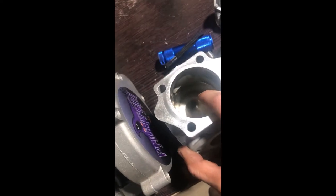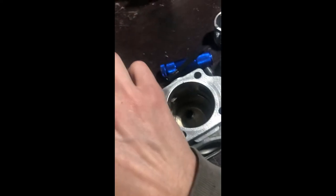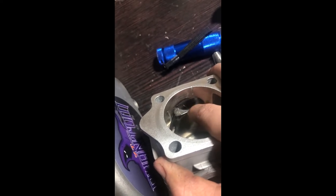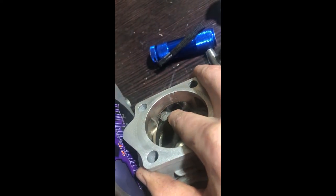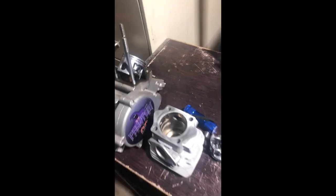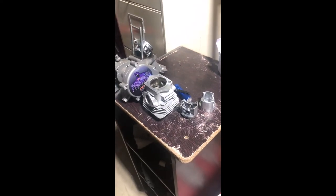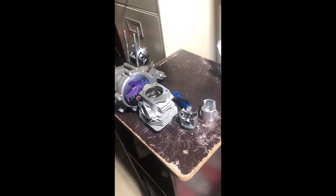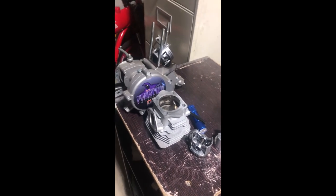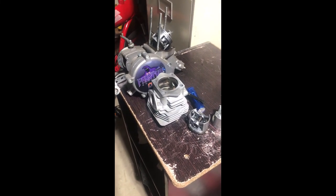One more hypothetical: if the one-ring-and-rotate fix still wasn't enough, I could put the ring end gap centered over the intake port by drilling a new locating pin hole there, then use a little JB Weld as a hump to keep the intake port covered when the cylinder is at bottom dead center, preventing the ring end gap from splaying outwards into the port. But yeah, that's enough rambling for now. If anybody has knowledge about fixing the Phantom 85 ring end gap issue or whether the newer motors have solved it, I'd love to hear it.